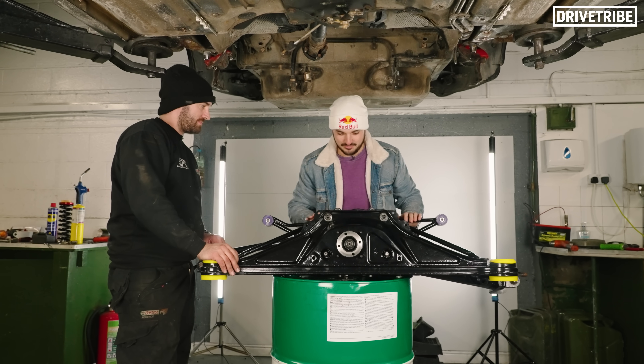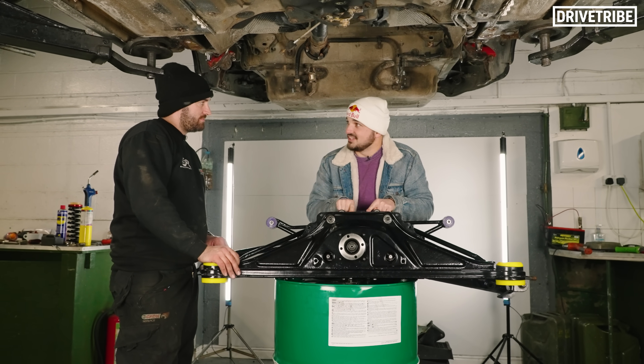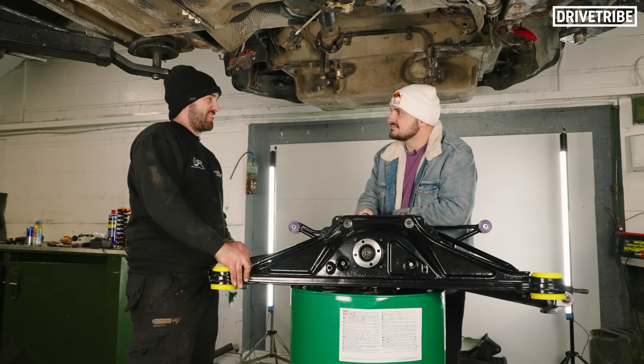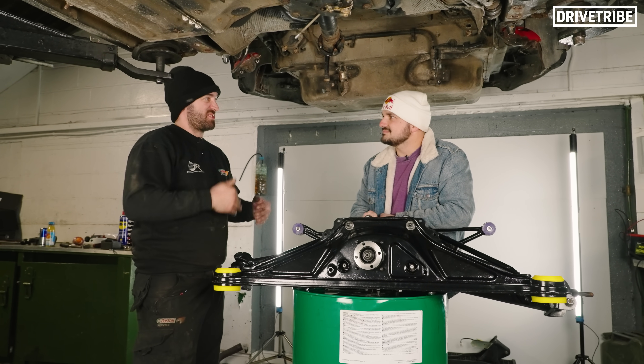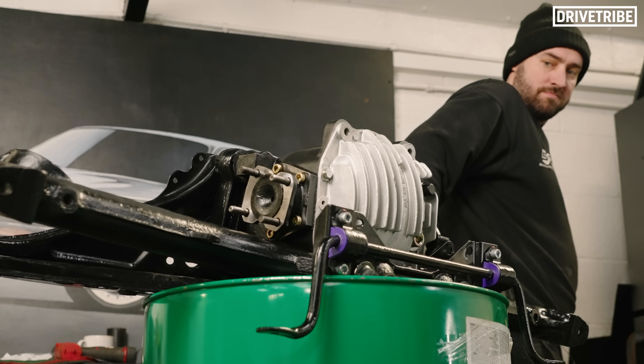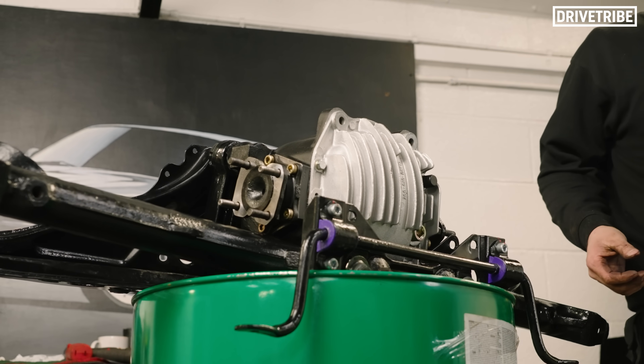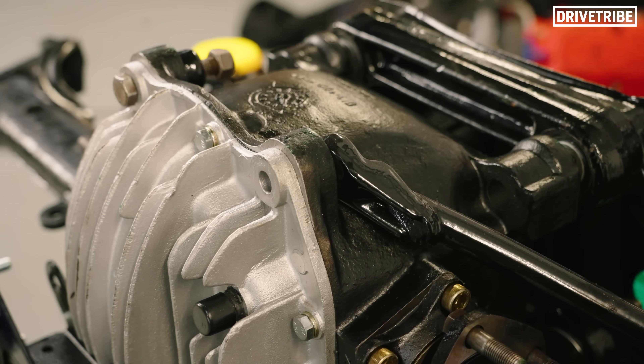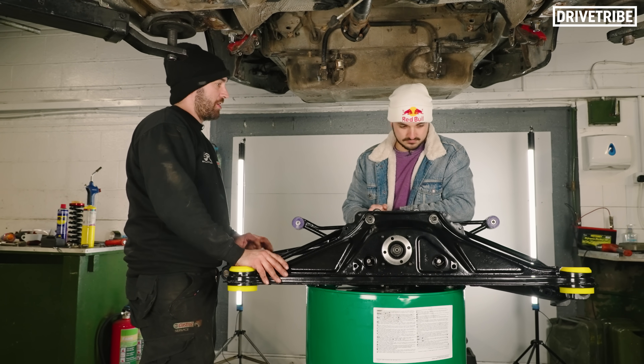Dan, this is looking pretty perfect. LSD — you have been told that the original XKs didn't come with it. Why? Honestly I don't know, probably a costing exercise or Jaguar just felt that the automatic gearbox wouldn't really notice not having a limited slip diff in there. How's it going to take on a 911 or a Merc SL with one wheel peeling? That's no use. We've gone for an upgraded gripper unit with our own custom ramp specs, and we have changed the ratio slightly as well so it will pick up and go a bit quicker.